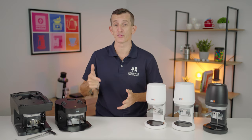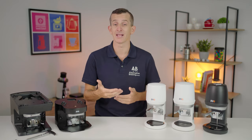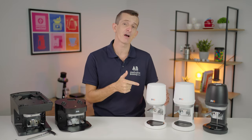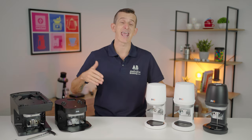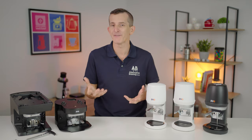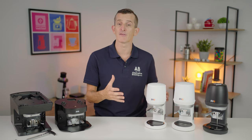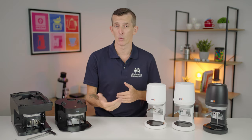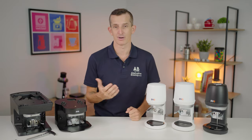This is the same with the M2, M3, and M5 of the M-Line Puckpress. Each Puckpress has its tamp cycle accumulating each time you use it, and you do want to make sure you're not exceeding these tamp cycles — 75,000 tamps in two years with the Mini, 200,000 tamps with the Q1, the M1, and the M4. It's mainly the drive unit which does the heavy lifting and can eventually wear out. Ensuring you don't exceed these mileages can lengthen their lifespan significantly. Within the two-year period from purchase, any breakdowns will be covered under warranty, and beyond that, drive units can be purchased separately to keep the Puckpress on the bench.